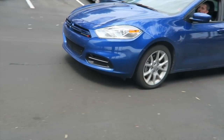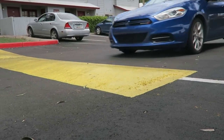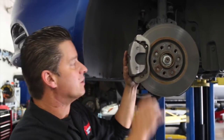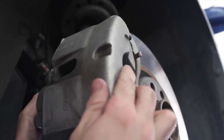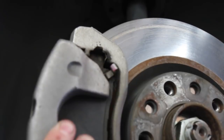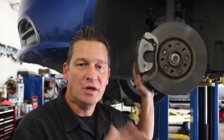When we went over those speed bumps, we heard quite a bit of a clacking and a clunk. It wasn't when we stepped on the brake — it was just as the vehicle was free-coasting at a steady speed. That was a quick way for us to identify the source of the noise. What we did discover is a whole lot of play in the brake caliper assembly — between the caliper unit itself and the caliper mount.